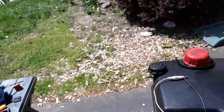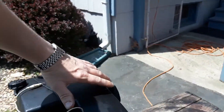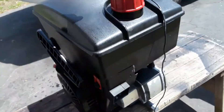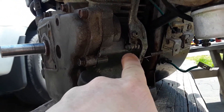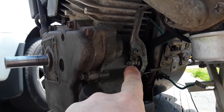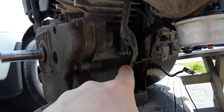It's a shame because they're a really great running engine. Let me turn this around so I can show it as good as possible. On this engine, it leaks oil out of the block right where the governor arm goes into the block. It's a widespread issue known on all of these specific models — the 5.5, the 6, and the 7.